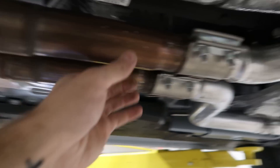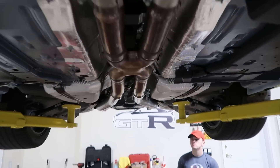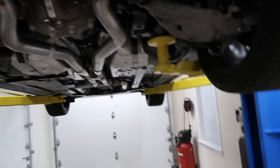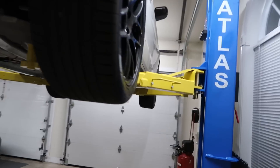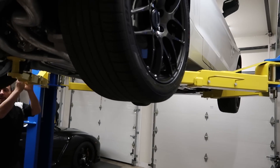Final walkthrough: Colin's mufflers didn't move at all — learned the hard way the first time that you've got to strap everything up. Clamps went on nice, everything's straight. Whoever put this one on before stripped the teeth of that nut so it was all jacked up. His pipe already has some good color in it. Clips are all the way on and it looks pretty good. Too bad it's not an auto because we could just remote start it to check for exhaust leaks. We've got to drop the car, let it run, and feel it.